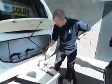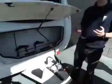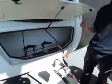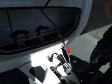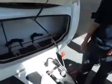Yeah. What we've got here is ATC. I don't know if you had that on your previous van, probably definitely not. It's a trailer control, so it detects movement like snaking. What it will do is apply the brake slowly on the caravan. It's operating off the electrics from your car, so you need that grey one connected, otherwise it won't be operating. It will do a self-test. When you plug the electrics in, you'll hear it do a self-test.